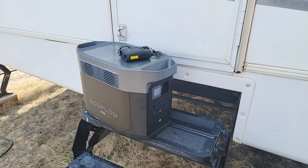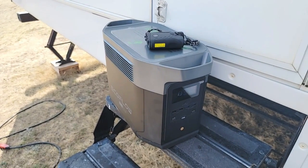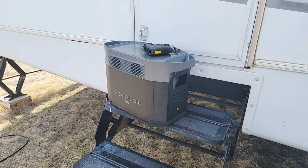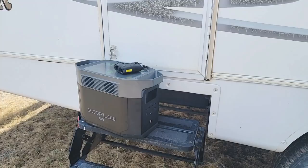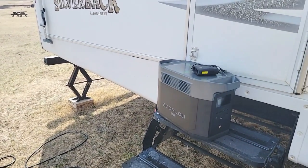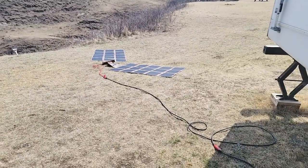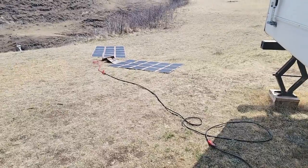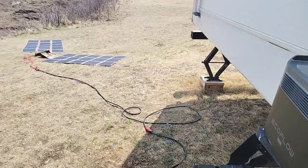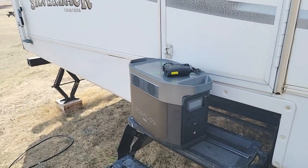For home use and emergency preparedness — hurricanes, natural disasters — this is a great product. Personally, we can run our fridge off of it. We've got a standard-size fridge with dual French doors on top and a freezer at the bottom. How long it runs for us is basically 14 to 18 hours. Fourteen hours would be if there's not a lot of food in the fridge — a lot of dead air that has to be chilled takes more energy. Up to 18 hours if your fridge is full of food that's already chilled. If you add an expansion battery, you're doubling that; if you add a second, you're tripling it.